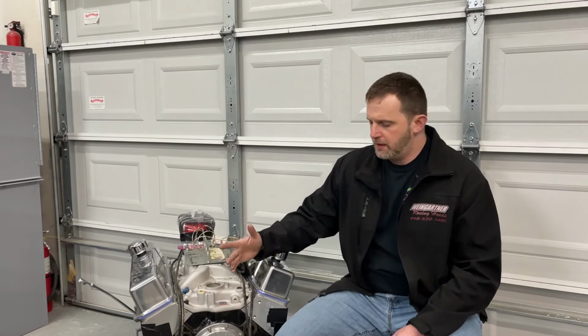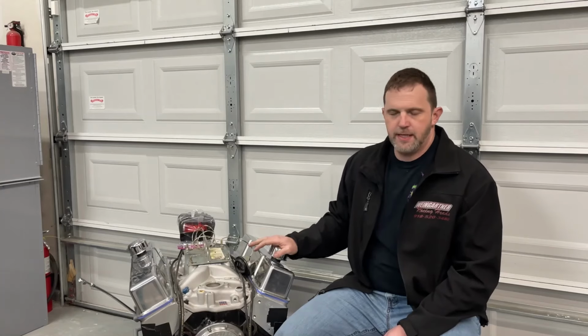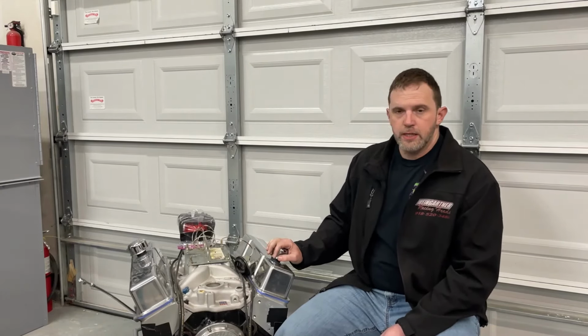Now, the place where I dynoed was different from where I dynoed the 406. This was in Enid, Oklahoma, because I wanted to go visit my mother, and that's where that dyno is. I have used that dyno many times. It was the first dyno I ever got on. I like it. It's a Superflow 902. When you look at his power numbers, I promise you, if I went anywhere else, this thing's going to pick up about 30 horsepower. Anywhere around here, any dyno I've ever been on besides his, it's going to pick up about 30. His correction factor does not have inertia calculated into it, and if you use inertia, it actually corrects up. So the numbers you're going to see, I would trust just about anywhere. I really would. So that's it.